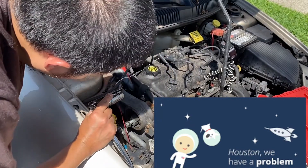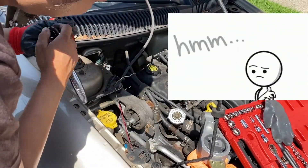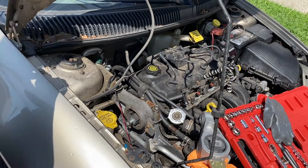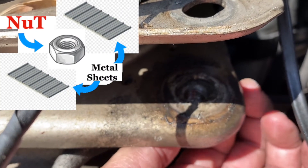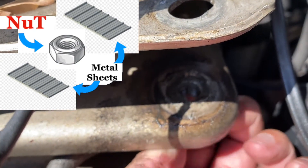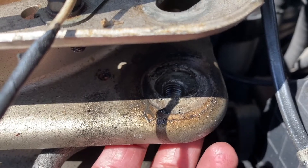There's a nut in the bottom here — it got loose but did not release the nut. As you know the saying, anything that can go wrong will go wrong, and this is no exception. This is the nut that gave me a problem — it is in between two metal sheets that's loose. So when I got the bolt loose, I wasn't able to properly take it out because it was spinning with it. And because the AC lines are in the way, it was so hard to get the bolt off. Good design, Dodge — make our lives harder, we like that.